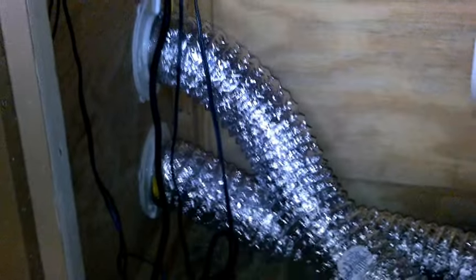If you do one of these, that's something you'll want to address. It took me a little while to figure it out — a lot of smarter people out there never posted anything about it, so I had to figure it out on my own. The hoses will hook right up on the side, pull air straight out through the unit to move the hot air out — just like a central air unit where the fan pulls through the coils removing the heat from the freon. This is the same thing, but the problem is this small sealed trailer just created a vacuum.